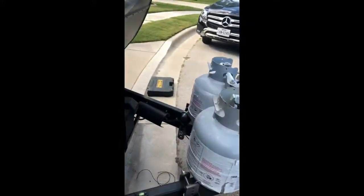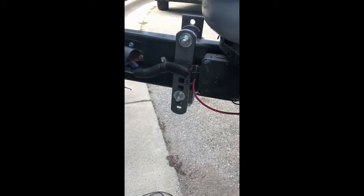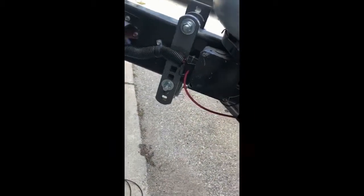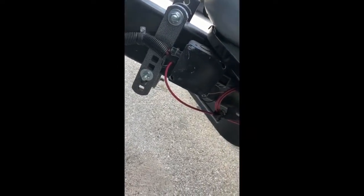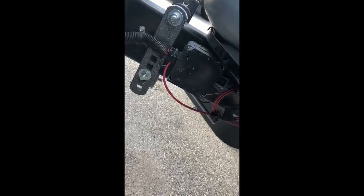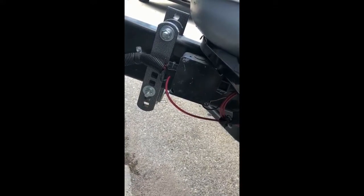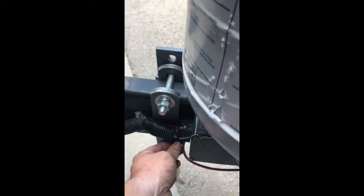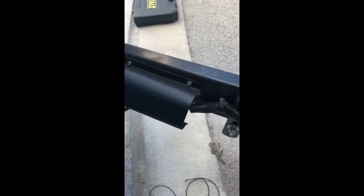For the wiring, one of the biggest concerns I had was actually doing the brakes and the lights. If yours is like mine, you can actually follow your seven-pin plug back and there's a junction box in there that had all the connectors for the lights and the brakes, and you could follow back from your safety switch. It was a little weird — the black was actually the positive for the brake on mine — but just using your voltmeter you're able to figure that out pretty easily. The porthole I showed you earlier leads down to a lot of these, so there's not a lot of extra visible wires. We were able to use the existing flex loom, and apart from two wires that had to come out to the bottom of the junction, it looks pretty factory — so nobody's going to come up here and know what wire to cut. That was definitely a big advantage.